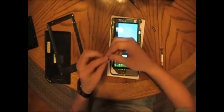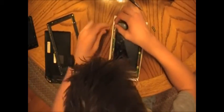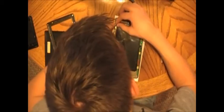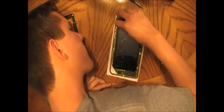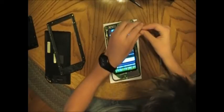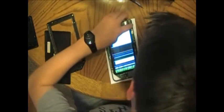We need to put the front cover on, and before we do that we're going to want to slide the power button in. Make sure it's right side up — the hook on the power button goes down. Make sure the blue physical power button on this part lines up with the button that will push it on the plastic power button. Then the volume keys — same thing, the hook goes on the bottom, make sure plus is on top. The volume keys didn't get dislocated when I was taking the case off, so you don't have to worry about lining them up.